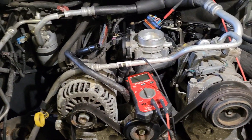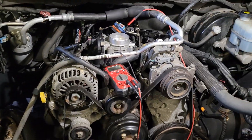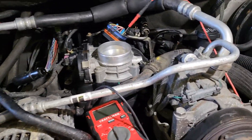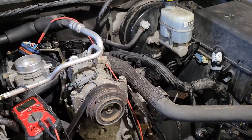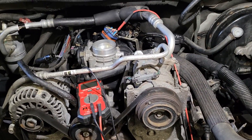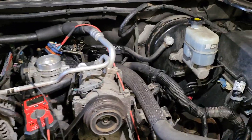I was just tinkering with my buddy Ross's truck — this thing has got a lot of miles on it, he uses it for construction. It's a little 4.3 Chevy Vortec and it's on its fourth or fifth transmission. We put some spiders in it a while ago and it keeps getting a code — very rarely — misfires. It's an injector number two circuit control code. I ohmed out the wire and it's point zero one ohms.